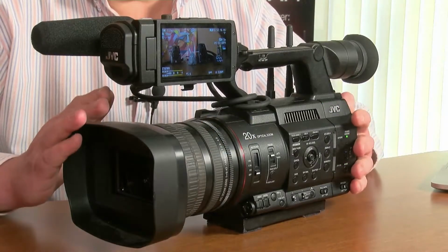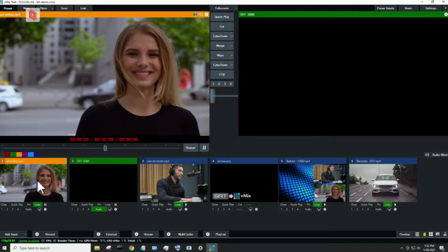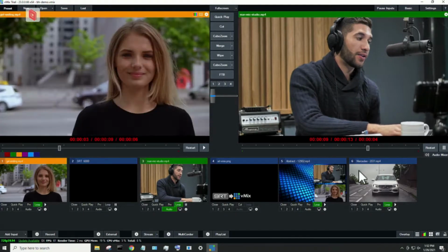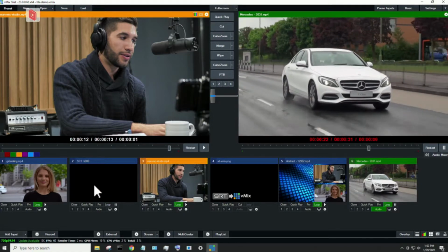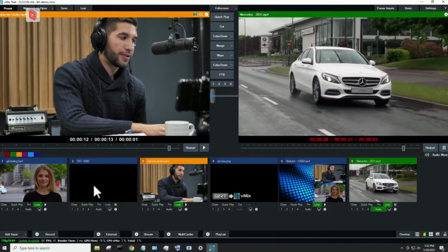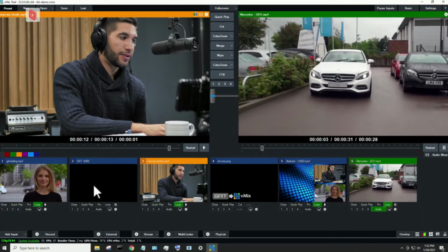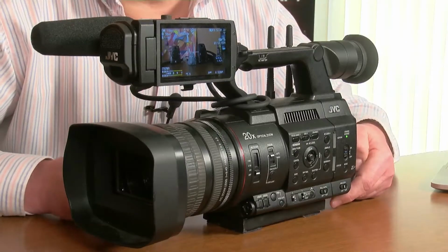So here's the camera on my desk, and this is the vMix control surface, which I'm controlling remotely using Parsec remote control. And you can see this is pretty much a standard video switcher, very similar to TriCaster or JVC KMIP series. I have multiple video sources here, and one of the inputs I reserved for SRT, and that is going to be an SRT listener input, and the camera will be an SRT caller. So the camera will be pushing the stream to the switcher. On the camera, I already programmed the IP address of the remote switcher.